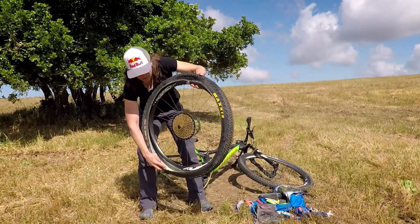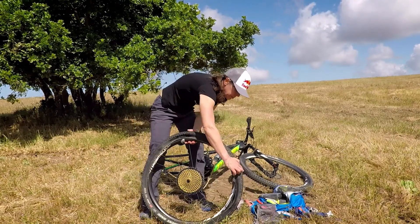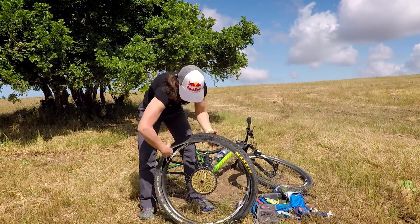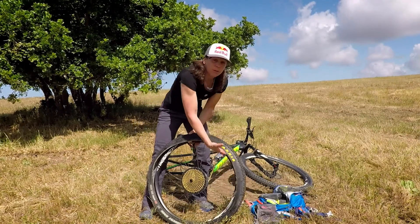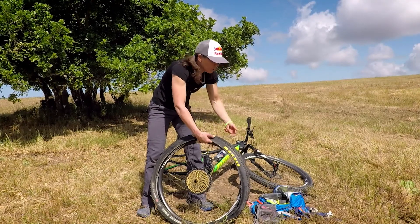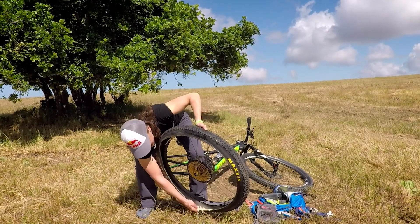What's important is to figure out why you got a flat. Look at the sidewalls — is there a big tear or big hole? Look at the base and see if there are thorns in there. You can also feel around with your hand, which is a really good idea, to see if there's a little thorn in there. Because if there is one and you don't pull it out, as soon as you put a tube in you're going to get another flat two seconds later — and I've done that.